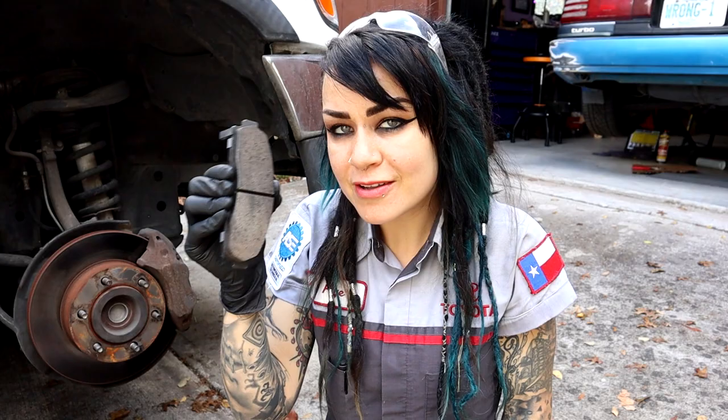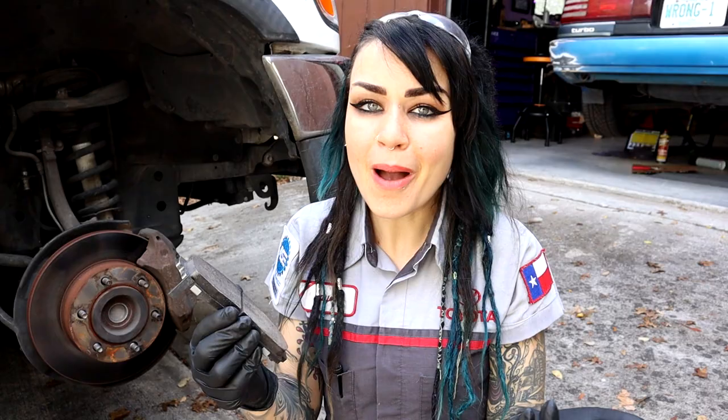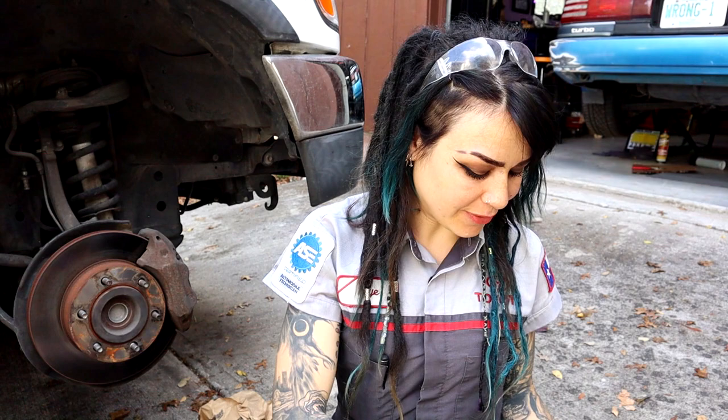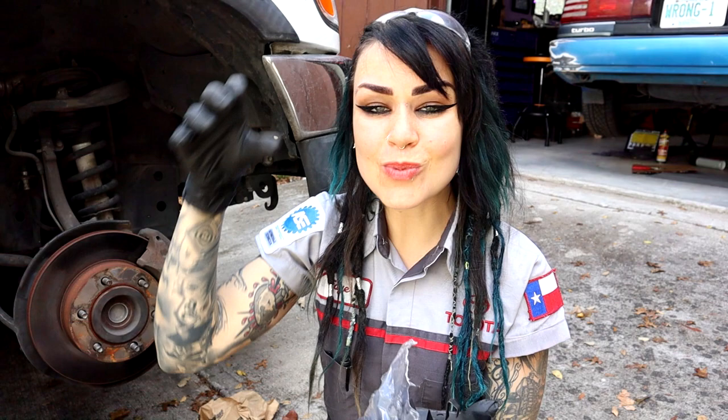Not all vehicles have this though. Some higher-end vehicles like BMW and Mercedes have an electronic sensor built into the pad itself. Not all brake pads come with the squealer tab built in either. Here's another box of brand-new brake pads — they're high-end ceramic brake pads — but none of these pads have the squealer tab automatically built in, so on this set they're relying on the mechanic to swap over the squealer tabs from your old brakes to your new brakes.